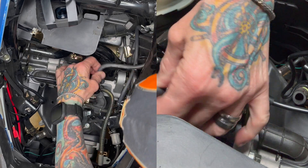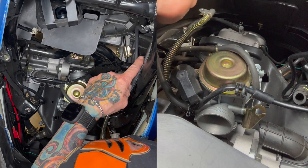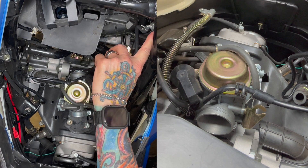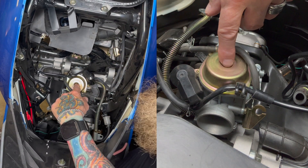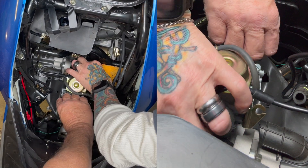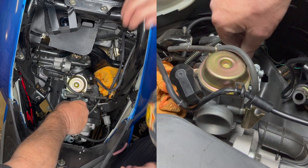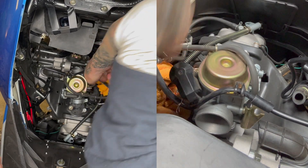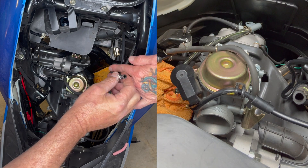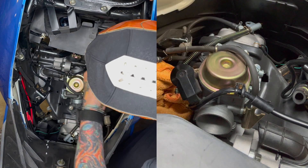Now over here — can I get a rag? This part right here is the fuel line, people. And if you'll notice, the fuel line does come up here to the fuel pump petcock assembly. This is supposed to open and close when you get vacuum to it, and the way you get vacuum to it — crank it. So once it starts cranking, it should open up and let fuel flow. We're going to take that off. I'm not left-handed so I can't quite get that off in there, so what I'm going to have to do is take a screwdriver. You always want to put a screw or something in there so we'll put that screw right back in there, just like that, so no fuel drains out of it. Stick that up over to the side, out of your way.